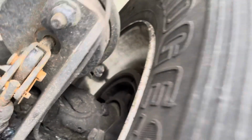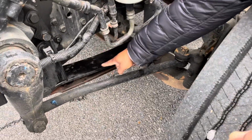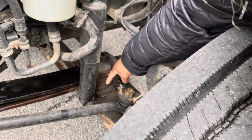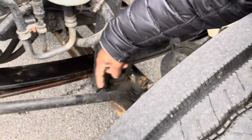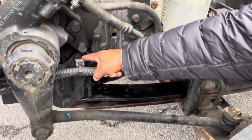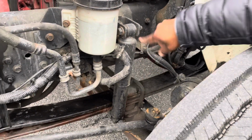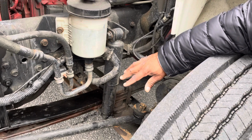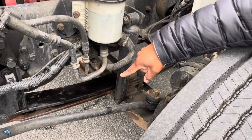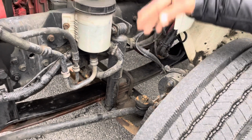All right. Now, system number 3 is the suspension. You have the leaf springs, the U-bolts sitting on the axle, held up by the hangers, and the hangers have hanger mounts connected to the frame and the shock absorber. And all of these parts are not cracked, not broken, and secure. No illegal welds, no loose or missing parts. The leaf springs are not shifted or missing, and no leaks from the shock absorber. Now, that's system number 1, 2, and 3.